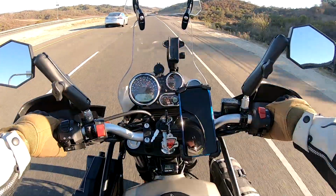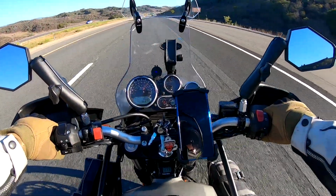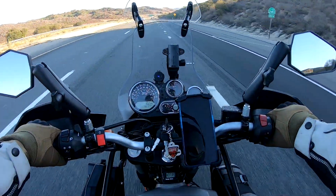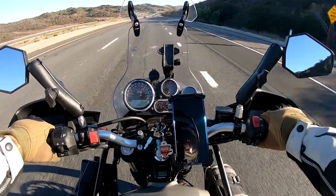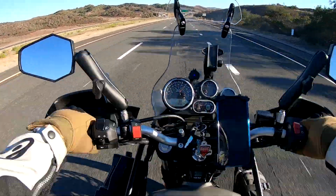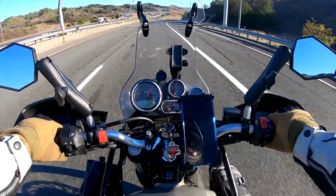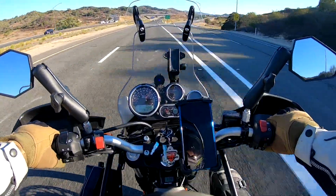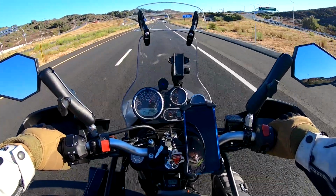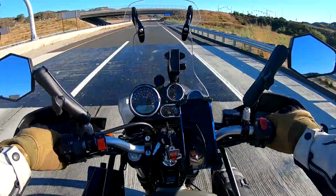I downloaded the fix. It's literally called the fix from GoPro's website and applied it. And I took out the SD card and formatted it with NTFS first, and then formatted it back with exFAT and put it in, and then I let it run at work recording what was going on in the office for about 20 minutes, and it continued to run and it didn't get as hot. So hopefully that fixed it. I don't know. I guess I'll find out when I get home, and then I'll figure out if I've been talking to myself all this time.